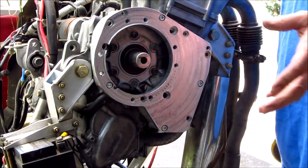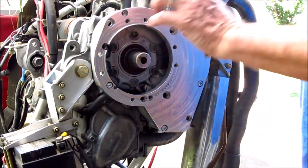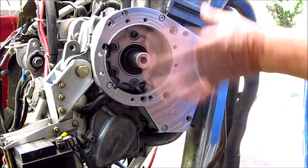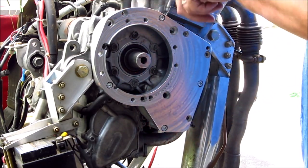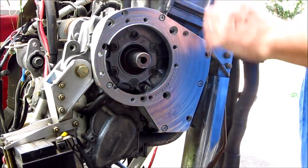What I'm going to show you is the installation of the Rotax on a YG4. It doesn't matter if it's an Apex or an RX1 — it's all the same with my adapter. Just a different adapter collar up here, and the plate has to be milled for the adapter collar.